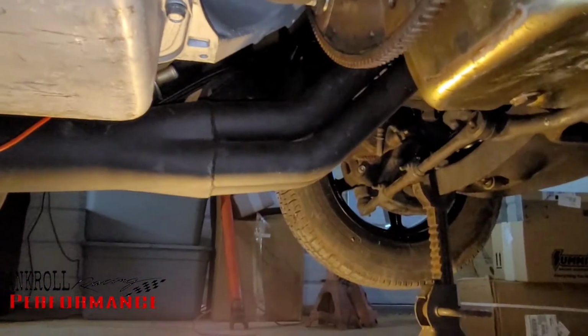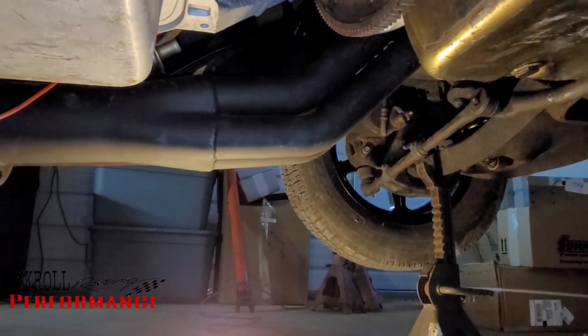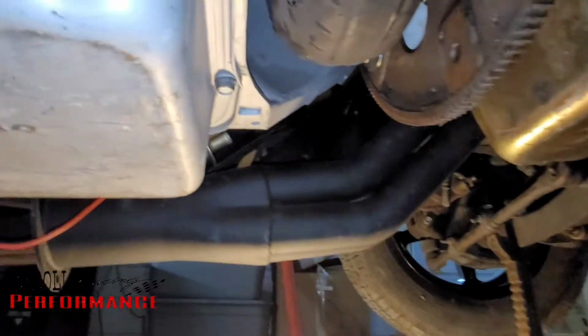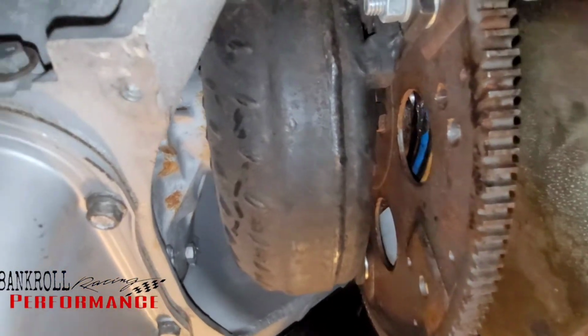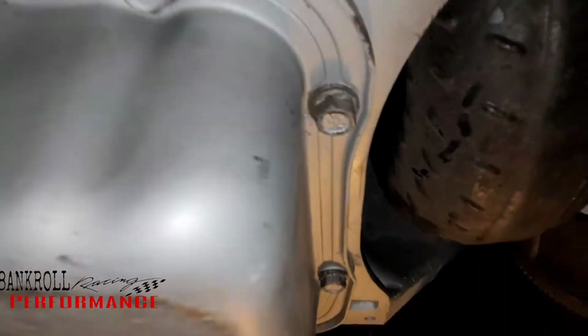But he said the pancake one didn't fit, but I had it on my other car, same kind of car, same kind of motor. I don't know what happened. I really don't. We gotta put a couple more spacers in this torque converter because he thinks one's enough, but whew, that gap is in there. It's a big gap, just waiting to burn up that new pump and this brand new transmission.